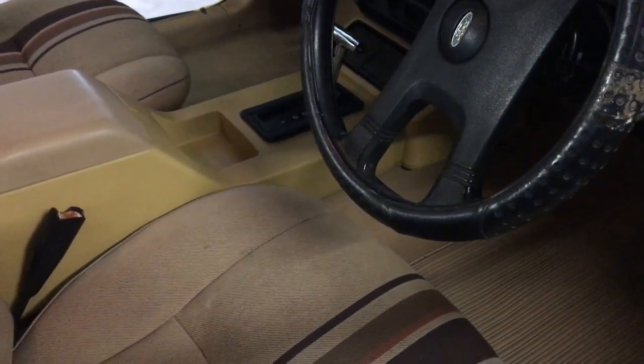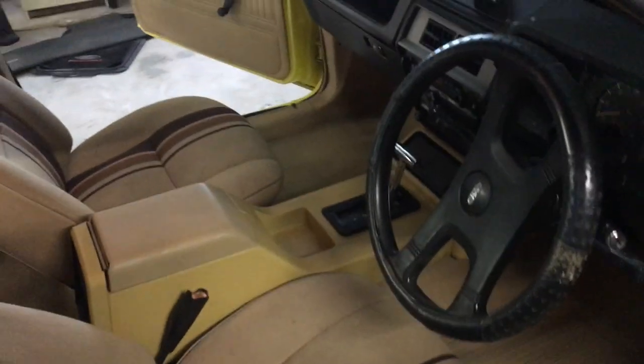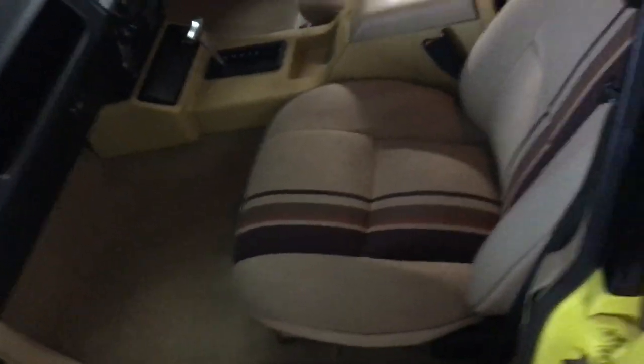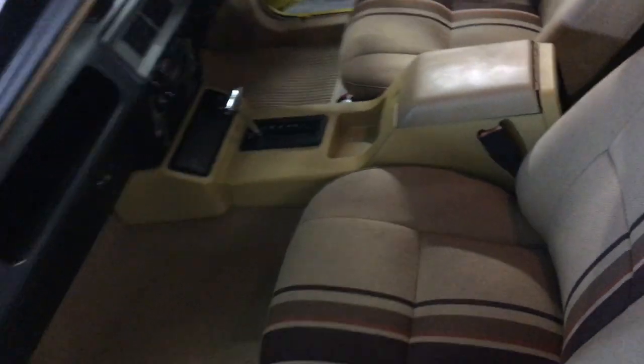After that, the light duty insulation goes in for the rest of the car all the way through. You also want a bit of padding for your feet so you're not hitting on hard insulation with just a layer of carpet - these little insulation pads come in a roll. Only do the area around your feet - do not go near the edges or the carpet won't go on. Don't go anywhere near here either as the center console is a very tight fit and will only handle the metal insulation layer, not the thick woolly stuff.